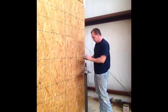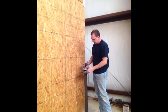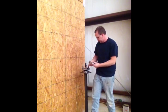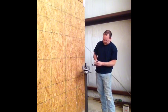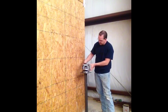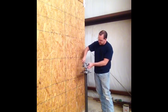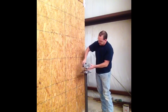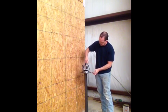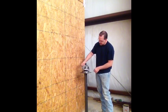Alright, then we're going to take our movable sheave, put it on. And we take our spider, find where we marked it, find where we marked this. Now this is going to turn here a little bit, but it'll even bottom out before you get it in where you go. Work it in there. Alright, now just turn the whole assembly. Be careful about your flyweights wanting to fly up, move up. So go ahead and tighten it by hand.